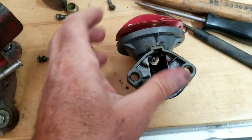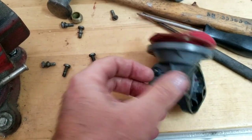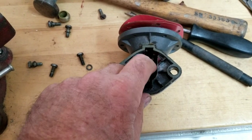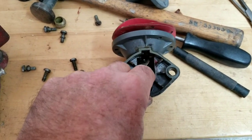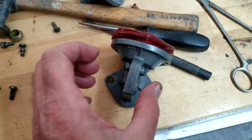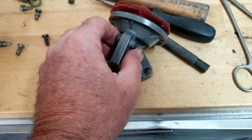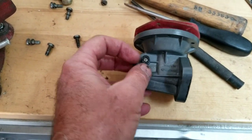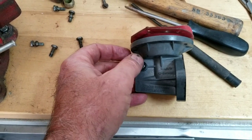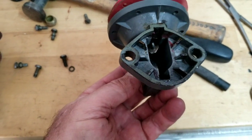That was the trick - the little bend on there. Got it down just right and got lucky and it hooked. Getting these two done, I had to do both as one assembly. When you get done with your fuel pump, make sure you peen this really good around here because it moves just a little bit. You might also want to use silicone to hold it in place after you've peened it really good. Peen both sides of this really good, then take your brush with grease and grease everything in here really well.